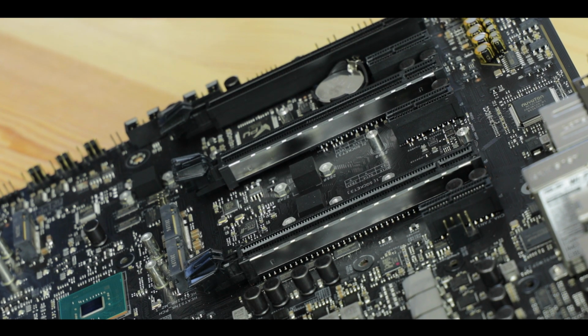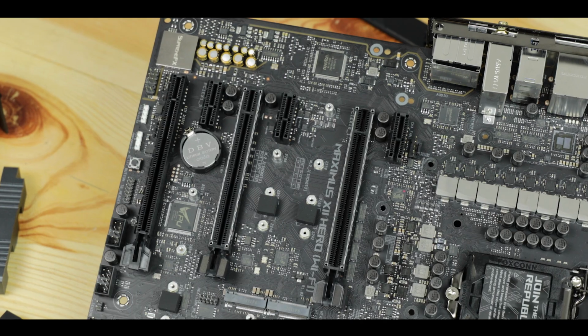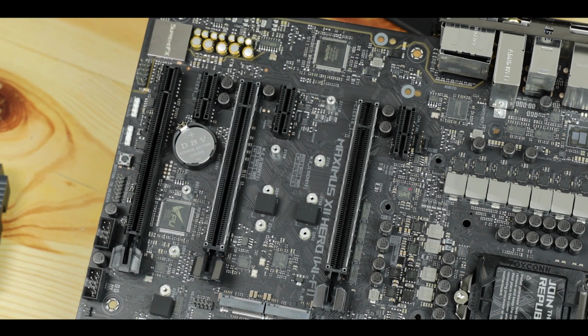Now again, keep in mind that as soon as you'll upgrade your processor to 11th generation Intel processor, hence a PCIe 4.0 processor, those 2 slots will be PCIe 4.0 compliant as well, doubling their bandwidth from 1 gigabyte per second to 2 gigabyte per second per channel. Now it's important to note, even though current video cards do not use PCIe 4.0 bandwidth level just yet.